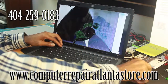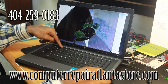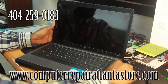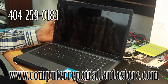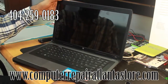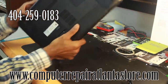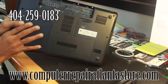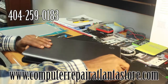First, since we cannot see anything here, we are going to power it back down. Make sure it is powered down and then disconnect the charger. Before you start disassembling the screen itself, turn the laptop over on its bottom side and remove the battery so you don't short out the screen. Here is the battery, the latch, and the battery. Set that to the side and then we can begin the process of changing the screen itself.